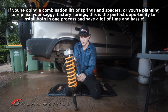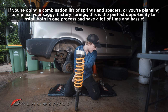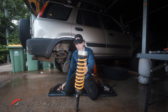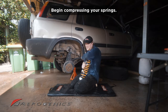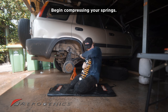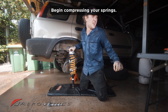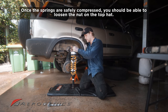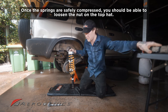First things first, we just want to get that first spring compressor on and get it tightened down. I'm going to be using my electric wrench where I can, but I know at a certain point it's not going to have any power and I'm going to have to wrench away. Let's see if that's enough. So what we're going to need is our 14 once more. There's this little nut and washer on top.